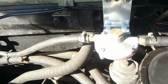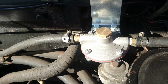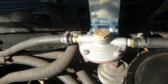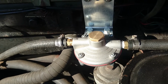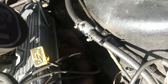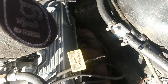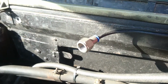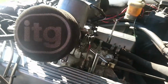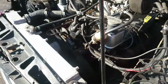So Malpassi fuel pressure regulator, because the Red Electric gives out 7 psi, and you really need to take these down to around about 4 psi. So we've got the Malpassi regulator, and then it goes through to a T-piece. So if you want to, you can just put a standard gauge on, and you can adjust it. So that's really easy to do. So you've got the fire extinguisher outlet for the engine bay there. See around this side. It's relatively clean under here. No problems there.